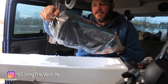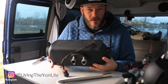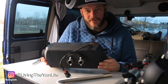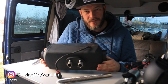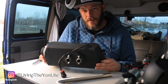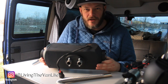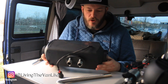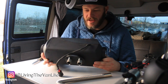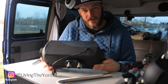And right there is the actual heater unit. The weight to this thing — I'm actually pretty surprised. What we've got here is a diesel heater powered off diesel, designed to operate off a 12-volt system. This one is a 5kW unit. I did some research and 5 kilowatts is approximately equivalent to about 17,000 BTUs. One of the things I was always excited about with my Big Buddy heater is it's an 18,000 BTU. So with this one rated at 5kW — approximately 17,000 BTUs — I'm hoping this is going to keep up with my cold weather camping just like the Big Buddy heater did.